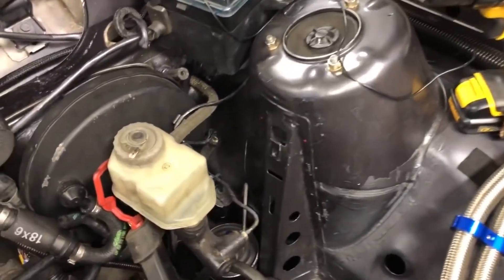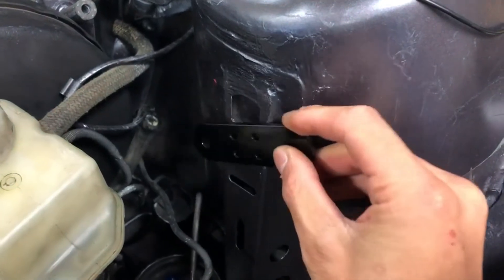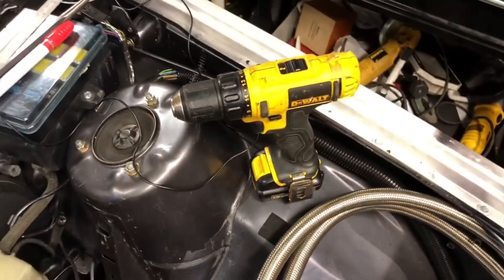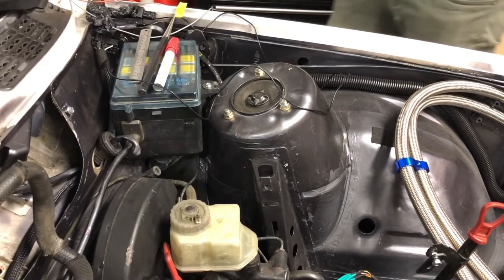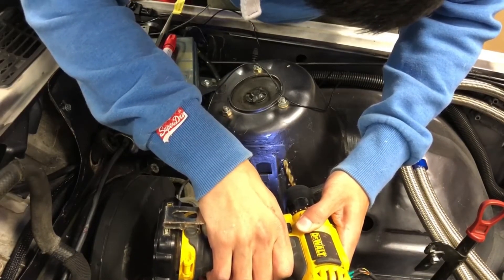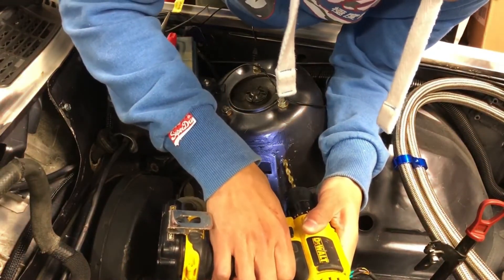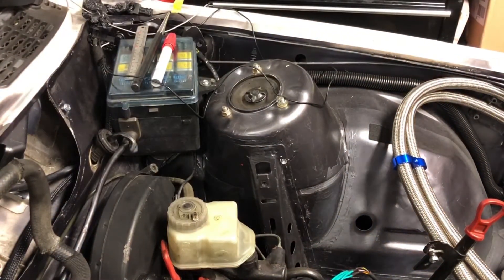I have marked with two red dots where I am going to be mounting the fuel pressure regulator. I will need to drill two holes in order to do so — this is really the only place I can mount it without having excessive length of hose. When using an electric drill, it is important that all sources of fuel are far away from the drill itself. The fuel pressure regulator is a must-have item for any electronic fuel injection system. Without it there would be too much fuel pressure build up behind the injectors and cause them to fail, but you also need enough pressure build up for the injectors to work properly.